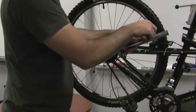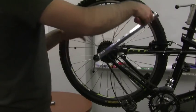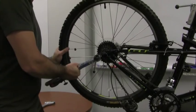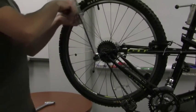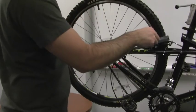You want to check that the distance is the same all the way around — if the tool is equidistant from the rim then you know your derailleur hanger is straight. If you find it's very far from the rim in one spot and touches in another, go to where the tool is very close to the rim and bend the derailleur hanger in the direction it needs to go. By going all the way around and making small adjustments each time, you'll be able to get the end of the tool equidistant from the rim all the way around.